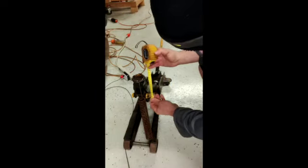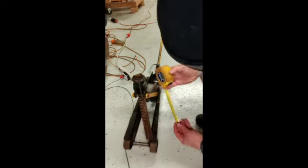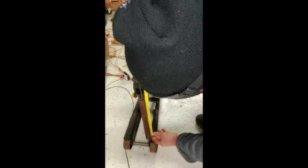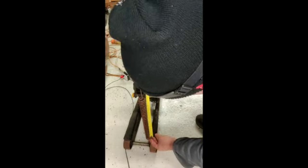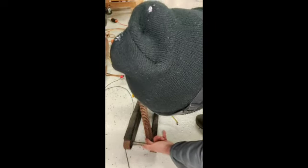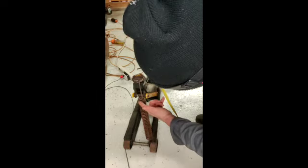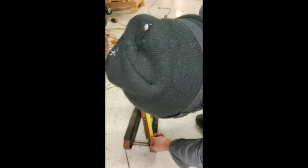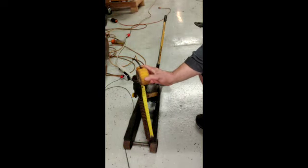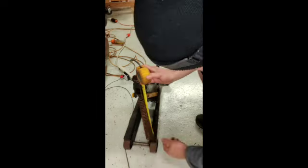If I subtract the length of this hook and that hook, I get the pieces of the tool I want to cut. I'll put a cross piece on the bottom loop, another cross piece on the top loop. Looking at a total height of roughly 9 inches, so I'll cut the tool to 9 inches in length and then weld in some cross pieces to slide into the spring.